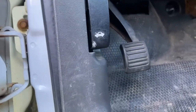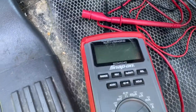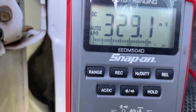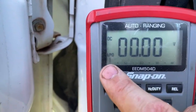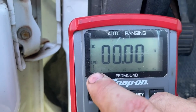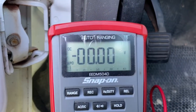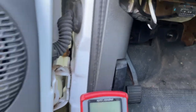When you're looking at comms on a multimeter, you want to range it to get all the noise out — because if you don't range it, everything looks the same. On this meter there's a built-in graph. If you've got it ranged out to about this level and you're doing diagnostics, you can watch that little line move. If it's moving back and forth, you're getting communication. But if it's way over to one side, that's a short to ground — meaning a module is pulling the system down and your stuff is not going to work.